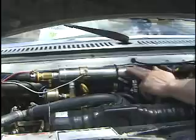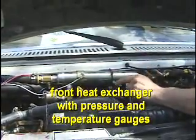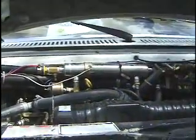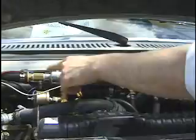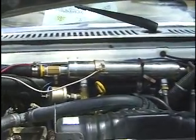This is the front heat exchanger, just before our vegetable oil fuel goes into the injectors. We want it to be as hot as the engine itself, so we have our engine coolant — radiator fluid — running through here through a series of interchanging pipes that allows the heat to transfer without the fluids exchanging.